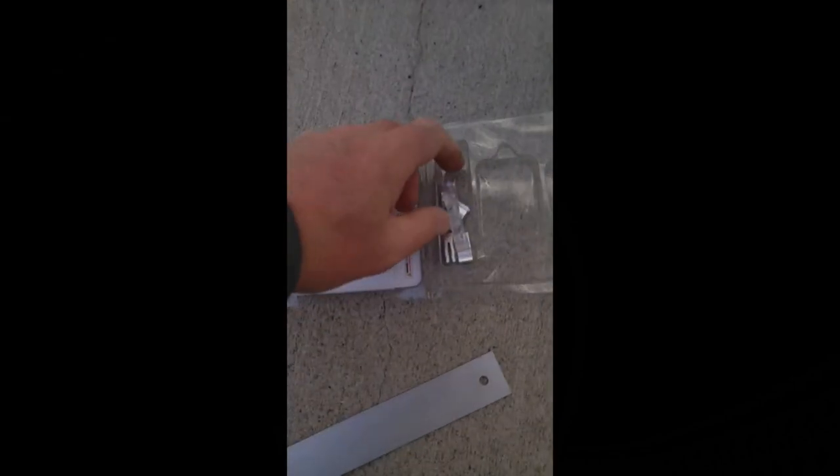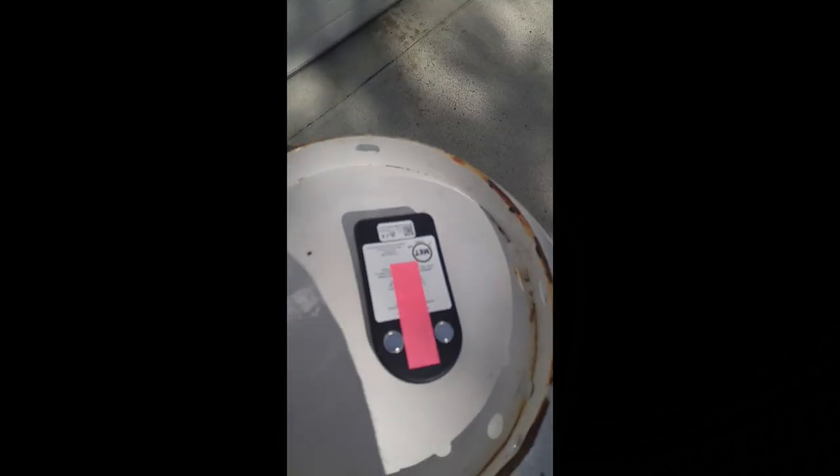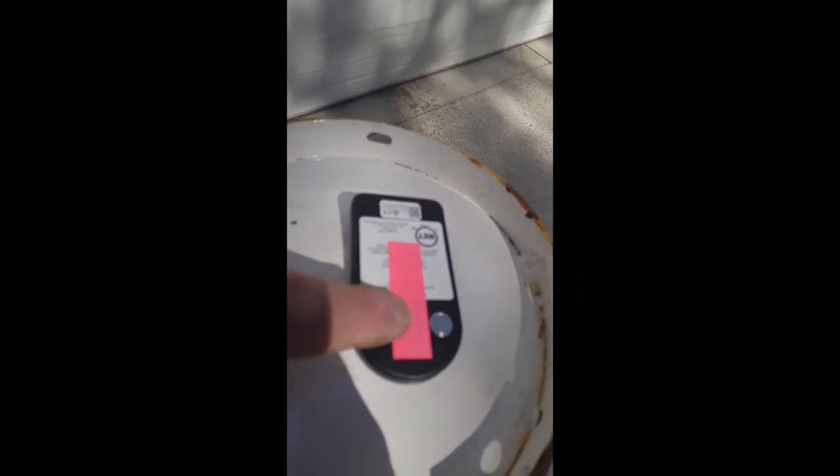There are spacers in here that will help with that. They also work in other ways — if you put the tank down on a metal platform that's completely sealed, those spacers will help the Bluetooth radio waves come out. Otherwise it all gets sealed up and you can't transmit. So those spacers do two things: one, they'll raise the tank up a little bit; two, they let the radio signal out more. Now that I know mine's a fit, we're going to peel off that little pink thing, put a little dab of grease right between the two magnets. That's all there is to it — it's installed.